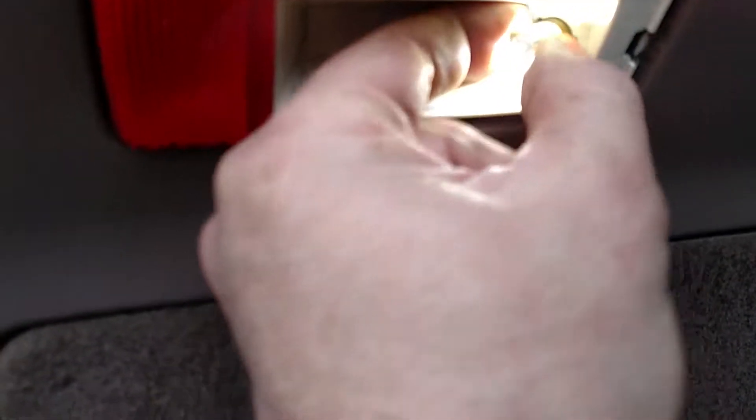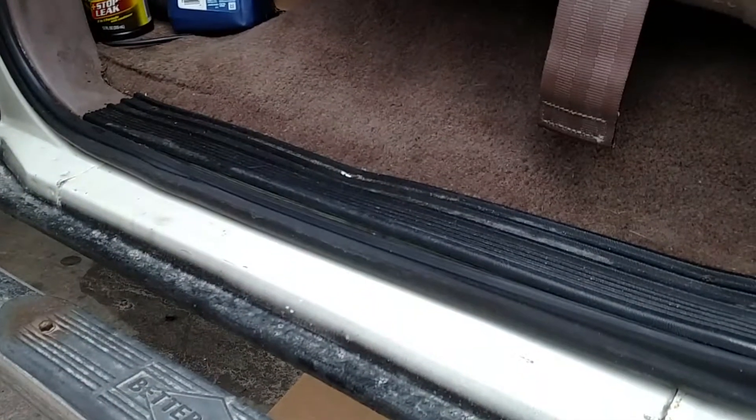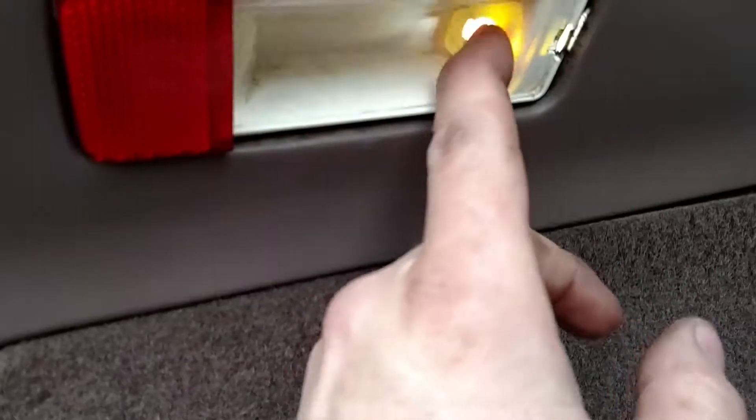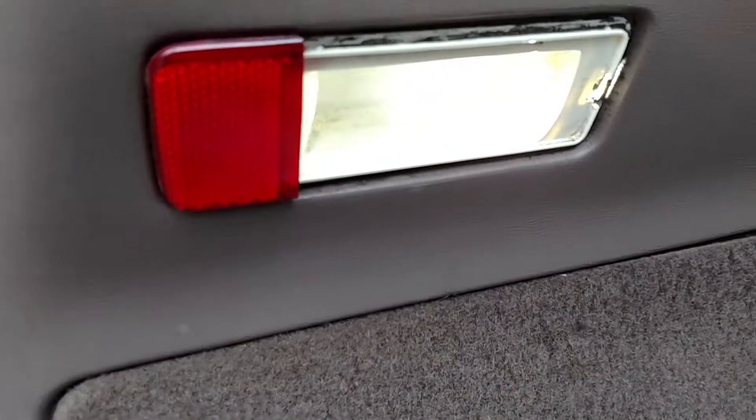Get it around the door pin and this weather strip. This cord is pretty short, so you can only get it off so far. Once it's off, you unplug this little guy from inside — well, it came out just now. Then you take the door panel off and set it in the door jamb. Then I can get my cable grabber down inside the skin of the door and splice these wires — I'm just tying it in to the door light.